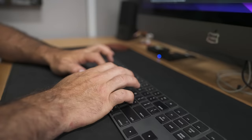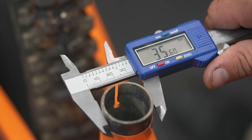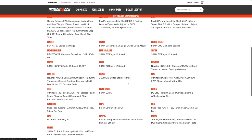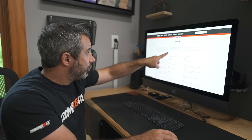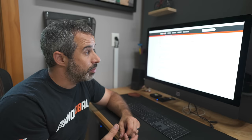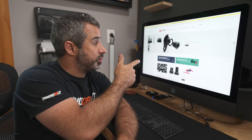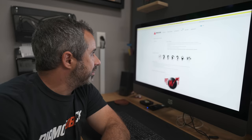The easiest place to start is the internet. I'm not going to just tell you to google something — I'm going to tell you to go to the manufacturer's website first, before you start taking out calipers and tape measures. They'll usually tell you almost everything that fits your bike. Here's my Diamondback 5C — if I go to specifications, it's all laid out on a silver platter. There are also companies that desperately want to sell you things and make it easy, like Wheels Manufacturing at wheelsmfg.com — they have a derailleur hanger finder where you select your bike brand, model, and year.